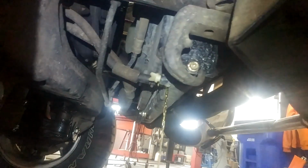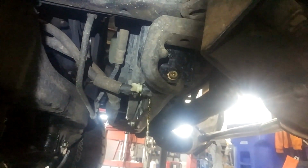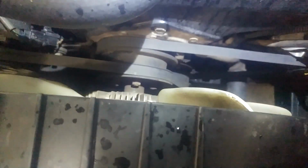There we go, we'll get the ball rolling. There, and we'll start taking stuff apart on the top. We'll be taking the 12mm nuts off the fan down here. Everything is going to be left to loosen, right to tighten. And we can take the fan off, and then we can take the fan shroud off.